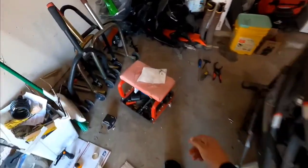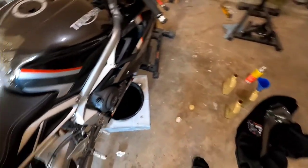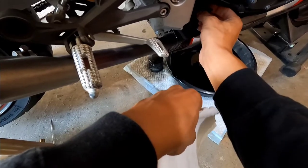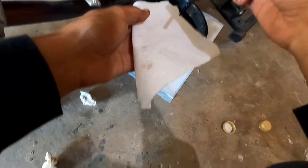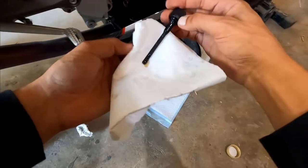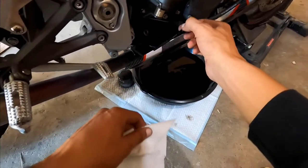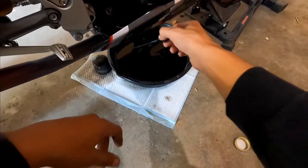Now, oh, pressure. Where are we at? We're low? Okay. So, I think the forum said 3.5 to 3.7. Actually, I think I need to wait 3 minutes to let all the oil sink into the oil pan. So let's try that, shall we?